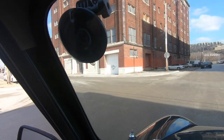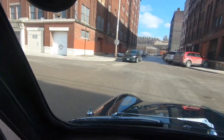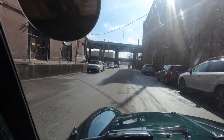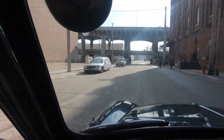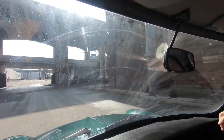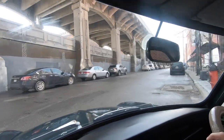Current gripes is that the speedometer cable makes a crap load of noise. And from what I understand, it's a real chore to change them on this car, because you have to take the engine off its mounts and at least tip it so you can get access to the place where it attaches to the transmission. This is insane.